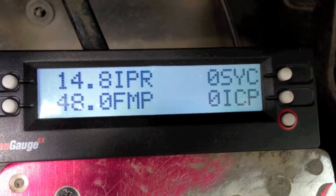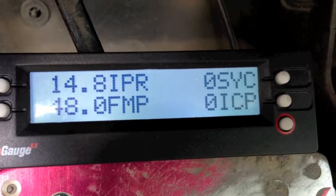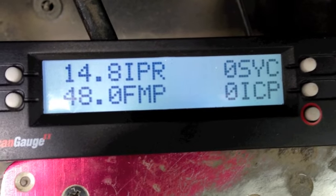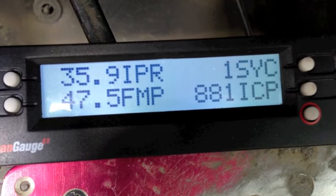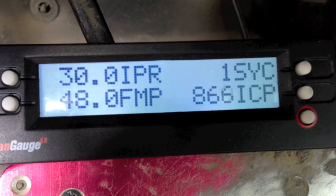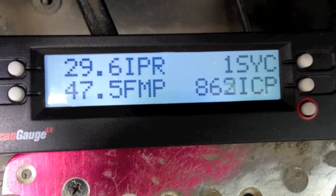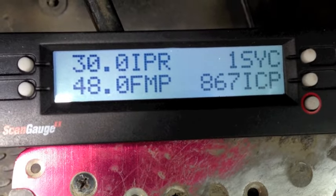Same truck with the belt removed. Battery is charged up and it's cranking over. I'm going to cycle the key, get the injector pre-cycle going, and watch the results. That one is a no-start because of the AC compressor — the AC compressor is seized. Everything else looks good. Another case study showing different scenarios and what to look for.